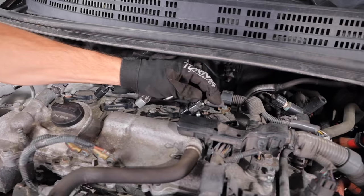Well, as you guys just saw, a quick tune-up was in order, and I've got to say, man, the spark plugs were in terrible shape. Have you ever seen a spark plug that looks that bad? It's pretty bad, man. And this thing was still getting great gas mileage, so nevertheless, that was a worthy job. As you guys just saw, we put some new formulation, high mileage 5W20 Valvoline synthetic motor oil into this thing, and I did a K&N oil filter.